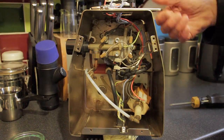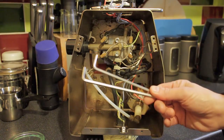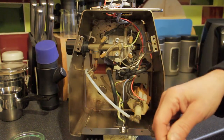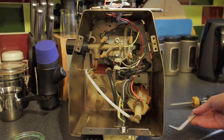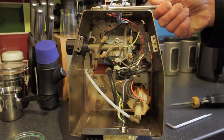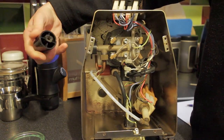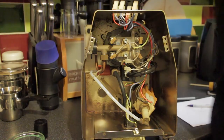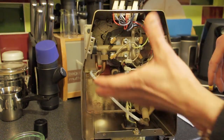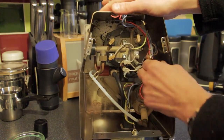Once you've marked the wires and removed them, you'll need a few more tools: a four and a five millimetre allen key - ideally long reach for one step, but standard length will do fine. You also need a 12 millimetre and a 17 millimetre spanner. Pull the steam control knob off the side - it just pulls straight off - which will give us clearance to lift the boiler away once everything's undone. Then start pulling off the electrical connections after they've been marked.